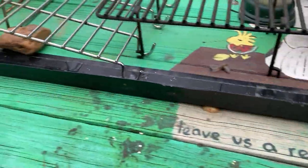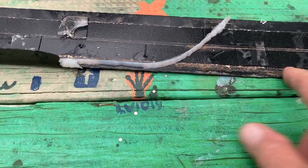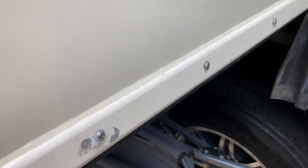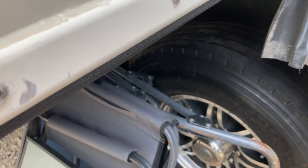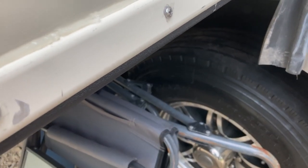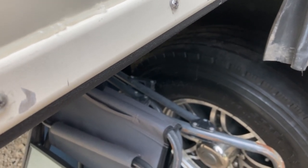The old ski that we took out — this whole front piece along here was tore out. The new ski that we put in there is a lot wider; it's four inches wide, and the original ski was like two and a half inches wide. The ski is what the slide rides on across the threshold block when your slide goes in, and it supposedly slips along that block so it doesn't tear up the bottom of your slide. That's what these skis do.